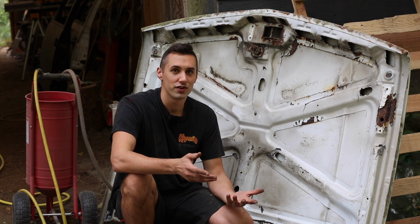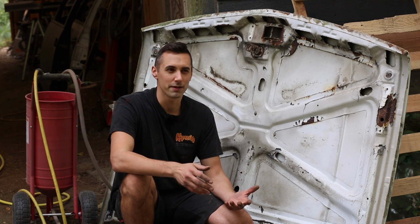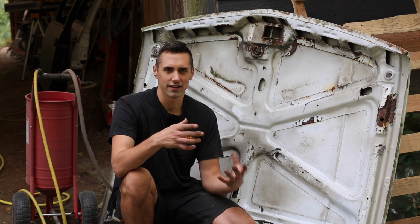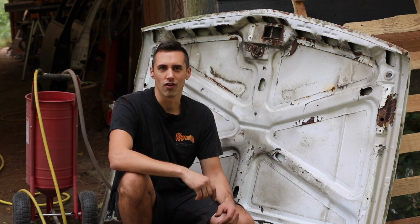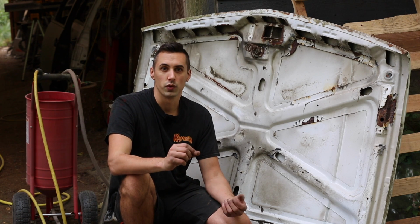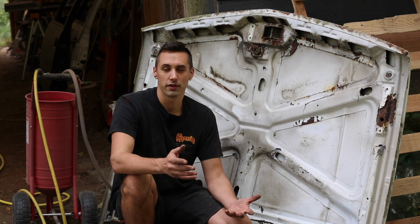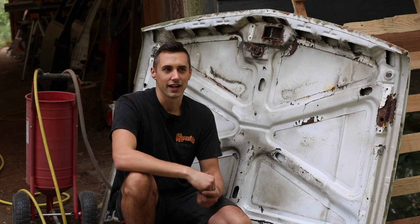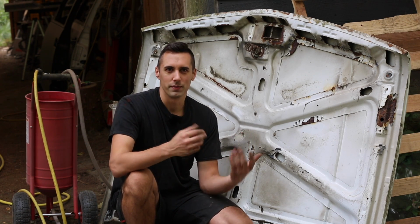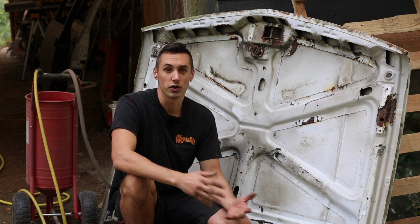In the past, I have tried using playground sand with it, and it sometimes works okay, but it does have a lot of problems. The playground sand that I was using has some small rocks mixed in, which clog the nozzle. It also has a lot of fine particles, which when mixed with the water coming from the air compressor cause mud and clog up the nozzle. So I guess it would be nice to have an air compressor that doesn't create so much water.